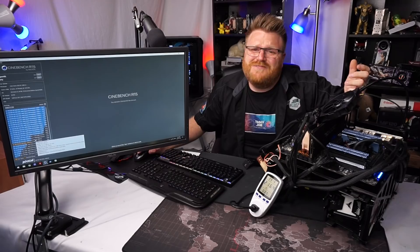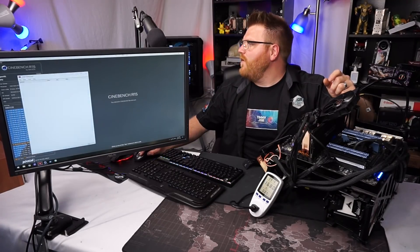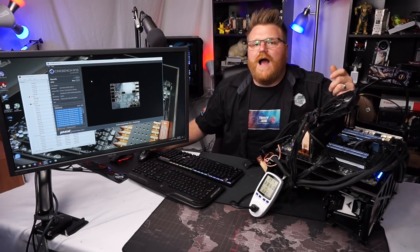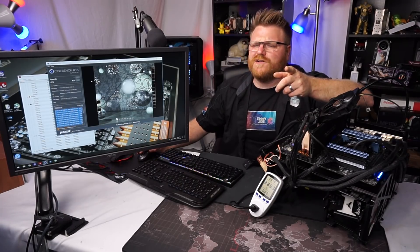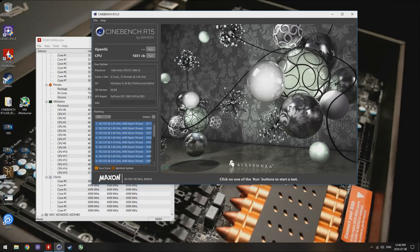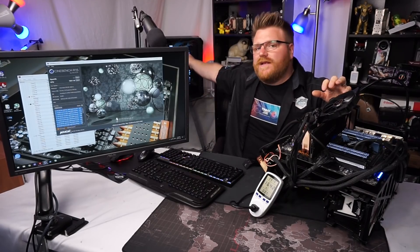The temps aren't really the problem - I just hit the wall, probably because this Xeon is soldered onto the die, just like Ryzen would be. There's no crazy thermal paste getting in the way. We'll launch Hardware Monitor and do a Cinebench run - this is not optimum performance, I've gone further than this will show. The 1680 version 2 scores 1651 in Cinebench. That's 1700 performance - that's better than Ryzen 1700 stock, and about on par with 1800X performance.